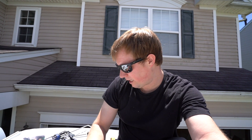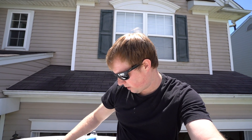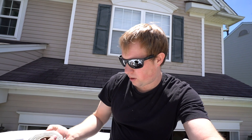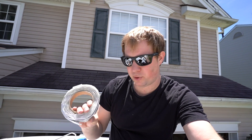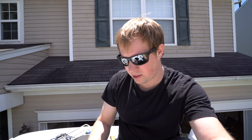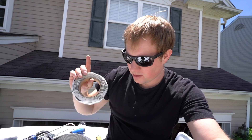We need a flat seam in order to keep water out of the van — very important part. I'm going to use a combination of rubber seals at different thicknesses as well as butyl tape, and then I will put Sikaflex around everything. Whenever I seal things I always have two lines of defense: an inner line and an outer line. I'll show you what I mean.